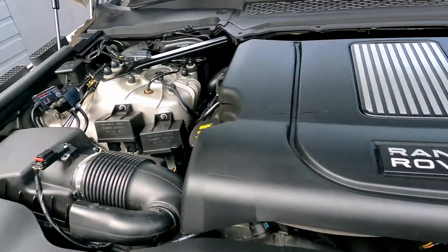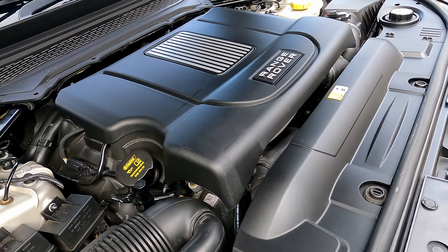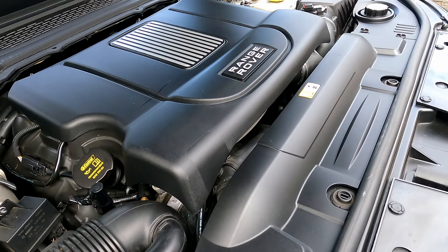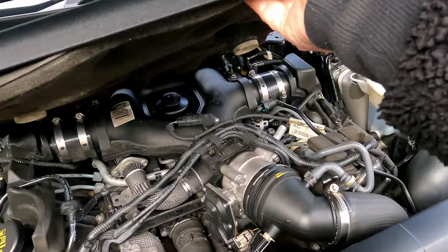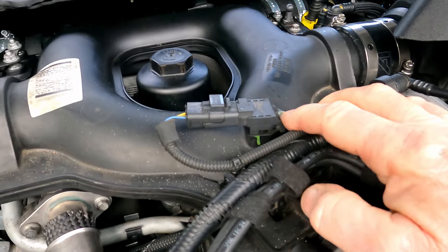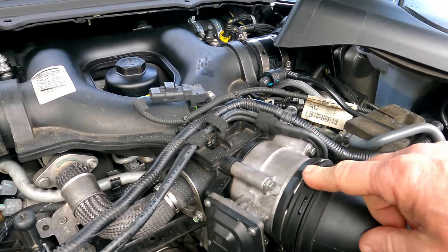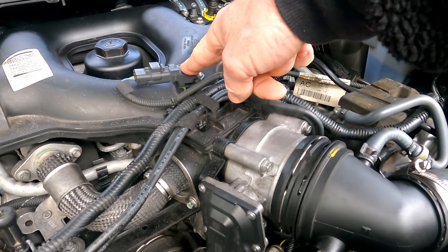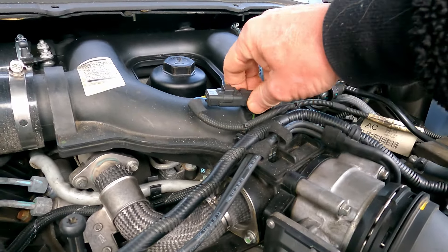So when we're going to mess about with the Range Rover, a couple of things I do on a regular basis is to have a look at the manifold air pressure or MAP sensor, which is underneath the cover. We've got the air intake coming in here, the EGR pipe getting into there, and this is measuring the pressure in the plenum chamber. This tends to get bunged up a bit with carbon.